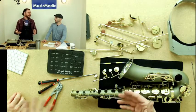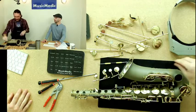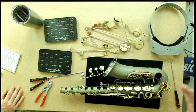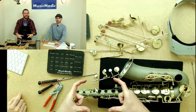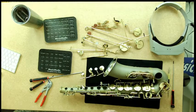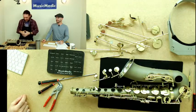Here's a useful tip I learned the hard way: this weekend I was repairing my riding tractor — a belt had slipped off, so I was taking off pulleys. When I went to put everything back, I couldn't remember which way a pulley was oriented. Had I just taken a picture first, it would have been much easier. Everyone has a camera on their phone — take a picture before you take things apart so you can refer to it when reassembling.